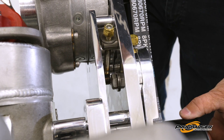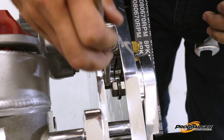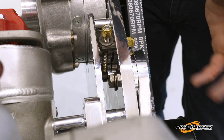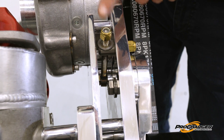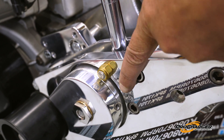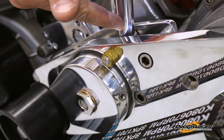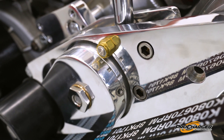To make sure your tensioner is all loose and ready to start adding preload, you have to make sure that the three-quarter bolt on the backside is loose, also the 14mm down here, as well as up on the top and on the front side of the bracket. When these come shipped to you, they're actually going to be tensioned down — that's just to make sure they don't rattle loose in shipping — so you have to loosen those up. Once those are loose, this will move freely, which allows us to start putting preload in using a 9/16ths on a drill impact. See that notch right there? There are two notches there and two notches there. This is the middle point for the tensioner, meaning there's no preload on it right now. As I tension this, the marker is going to come near the tension markers — I try to set it right in between the two notches.